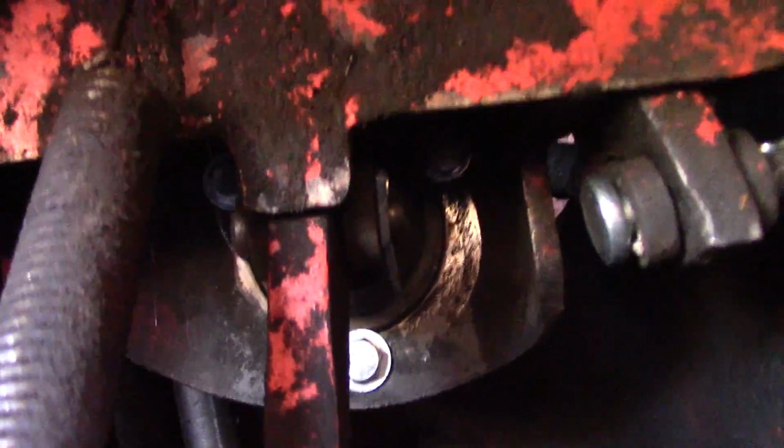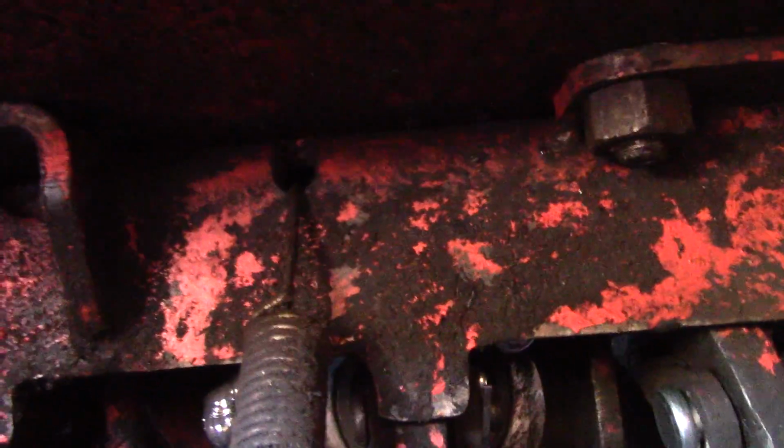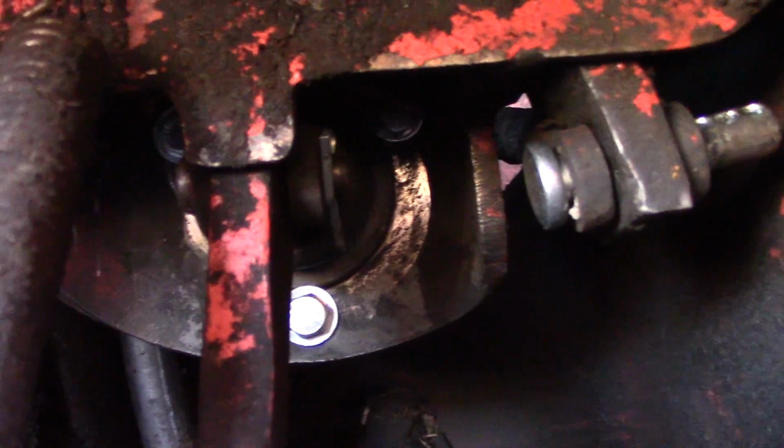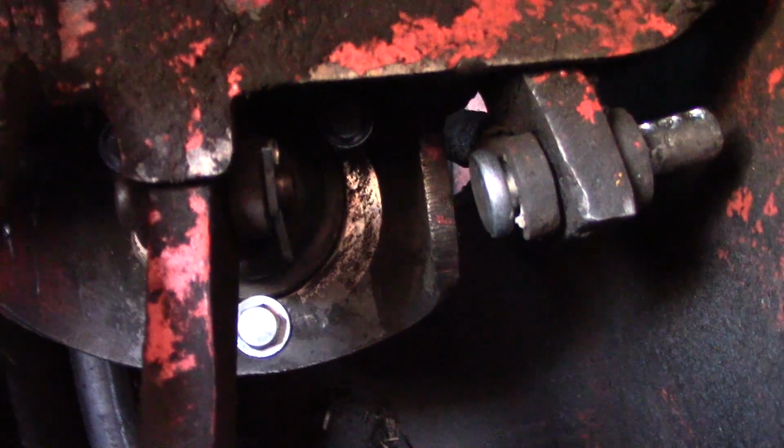The bolt pattern, I don't know if you can see the light in here. They mount down in. You have to take the whole pedal assembly down out of there, but it didn't take much doing. I just had to take a die grinder and grind out the big diameter where the plunger comes through, that circle. I only had to grind that out a little bit, and it fits right in there.